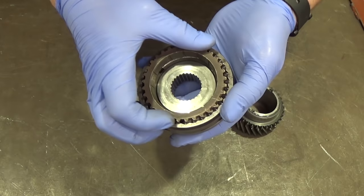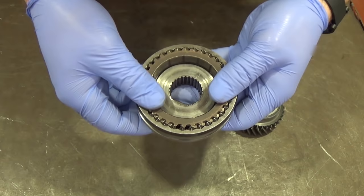When the baulk ring is placed in the unit, you can see that the outer sleeve will only slide over the baulk ring when the shaft speeds are synchronised, guided by the baulk ring dog teeth.